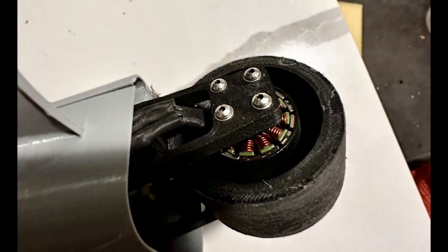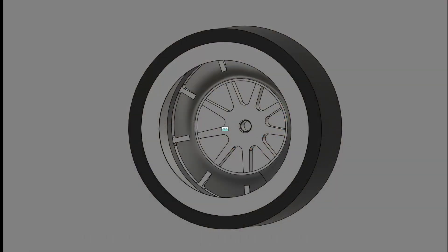I went with a much larger 31 millimeter by 20 millimeter stator outrunner brushless motor, capable of in theory 200 miles per hour, but in practice probably 160 to 170 is going to be its top speed. I also made changes to the rear tire. Previously I ran a 64 millimeter overall diameter rubber rear tire, but above 120 miles per hour you really have to run a much lighter EVA foam tire because at 15,000 RPM these tires experience a phenomenal amount of force trying to rip them off the rim. I went with an overall diameter of 85 millimeters on the rear wheel, which lowers the RPM and means the tires experience less centripetal force.